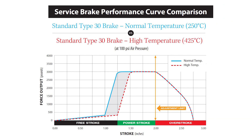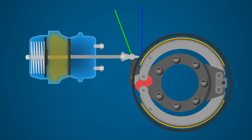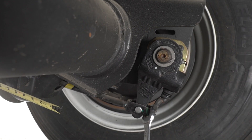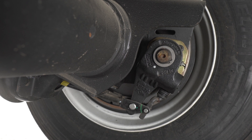With a 100 PSI full pressure application, a 30 square inch brake chamber exerts 3,000 pounds of force on the pushrod. That causes some deformation in the brake components, and it even expands the brake drum a little bit and compresses the brake linings. If a free stroke measurement showed 1¾ inches, a full pressure applied stroke measurement might be at or over the 2 inch stroke limit. Free stroke measurement can give you a false sense of security.